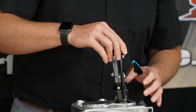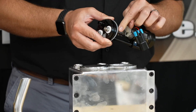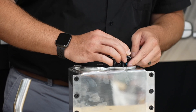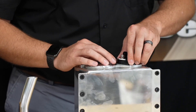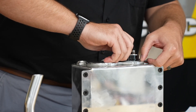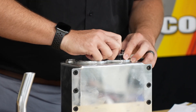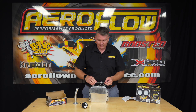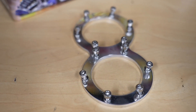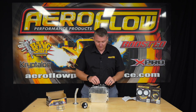So this basically just drops in. You'll be removing the plug to put ring connectors on the end there onto the terminal, but just for the example we'll tuck it in. That just drops in there — it's got a nice Viton O-ring to seal it. Sit it into the space. Make sure you use a small amount of lubricant on that O-ring so we don't pinch it when you install. That unit drops down and then, the same as always, this ring just goes straight back over the top. Bolt the collar down and that'll lock the pump module or the adapter into place and you're ready to go. There's a Dash 6 AN fitting on the top and two terminals. It's as simple as that.